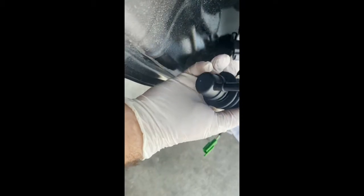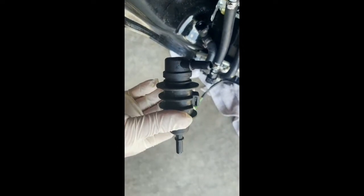There's going to be a lot of fuel inside this filter so be careful. Squeeze these two, pull it — make sure you don't slip out — boom. Here is your fuel filter.